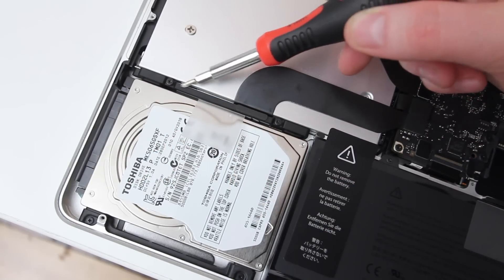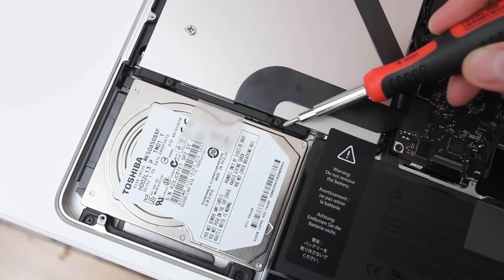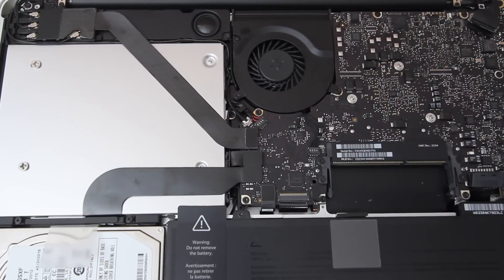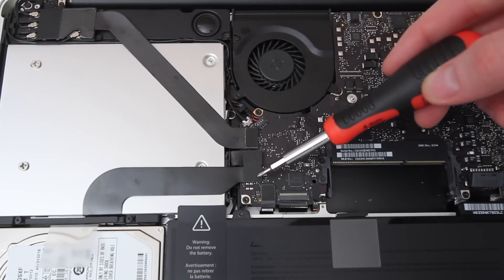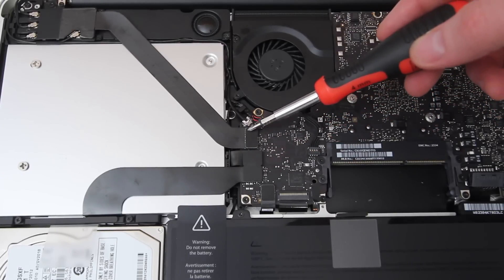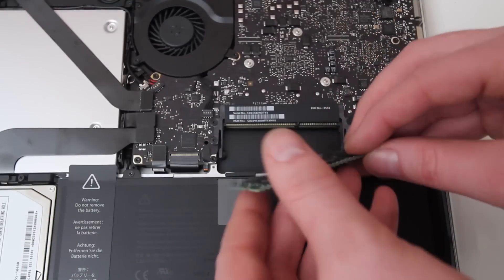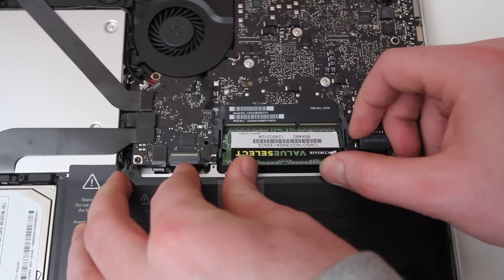As you can see, we're completely finished. We have two drives installed — one much quicker than the other — but both running on SATA 3. We're going to get great performance and still have a bunch of storage for backup, media files, and everything else. You're going to want to reinstall all the components tightened back where they came from, and also make sure to plug in all the ribbon cables that originally came off the board when you were removing the optical drive.